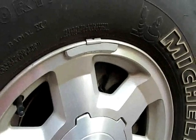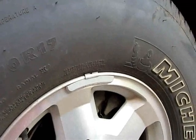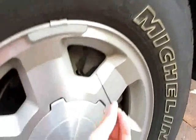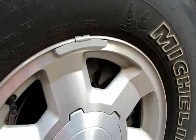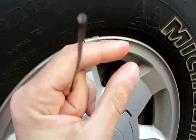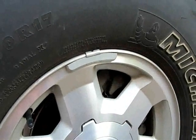You can also look at the brake master cylinder, but that doesn't always give you a good indication of how low the brakes are, because as the brakes wear, the piston's going to be out more and your brake reservoir level is going to drop. It's dropped a little bit. This vehicle never really drops very low — maybe about that much. Other vehicles will almost go to empty depending on the capacity of the vehicle and what kind of braking system it has.